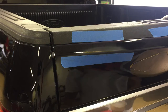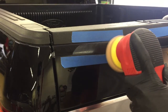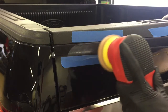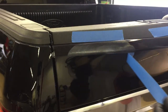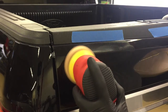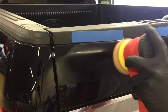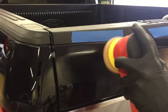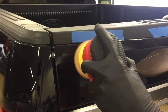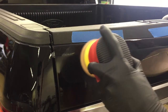This looks good and ready for the next step. We're going to get our 3-inch Griot's Garage polisher and 3-inch pads. We're going to use some Angel Wax compounds — starting with a cutting compound to refine the surface, then stepping to an ultra fine after that, which will be the pre-wax, pre-sealant, or pre-coating step taken last. I remove the tape so we can make the area we're compounding a little larger than what we were sanding — that's part of the blending-in process.